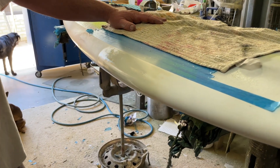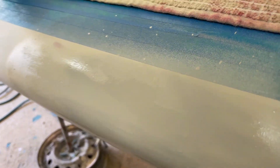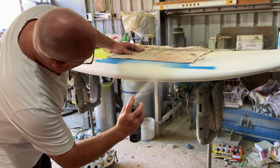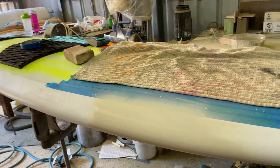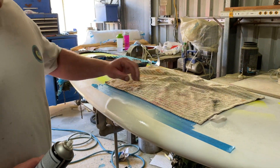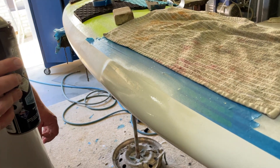Looking at the tiny little pinholes — I think they're bubbles in the paint so we'll keep going. There's a little bit of texture to it, a little bit of orange peel, a few drips, because spray cans are awful compared to a spray gun. We'll cover that when we paint properly, but this is why spray guns are lovely. For priming it doesn't really matter that the cheap product has put a few lumps and bumps on it, because we're going to sand that off a little bit later.